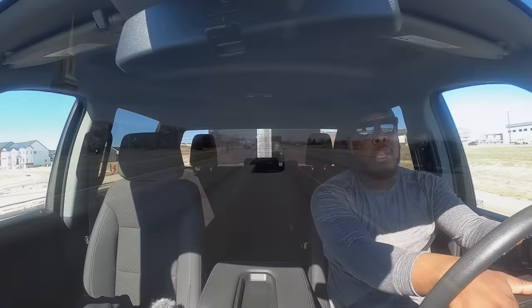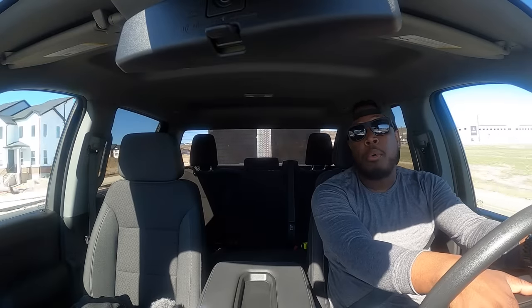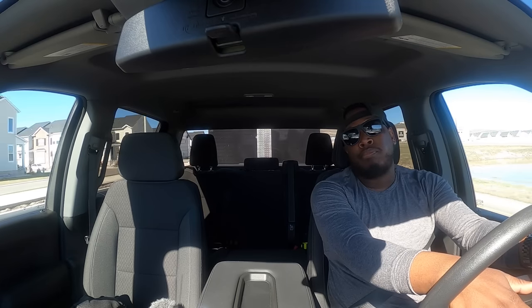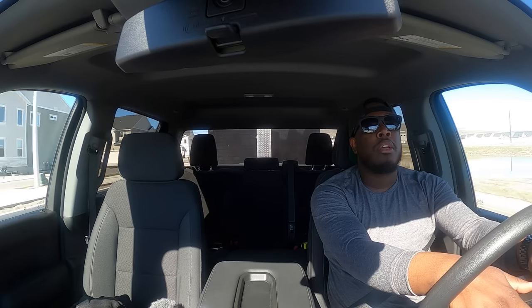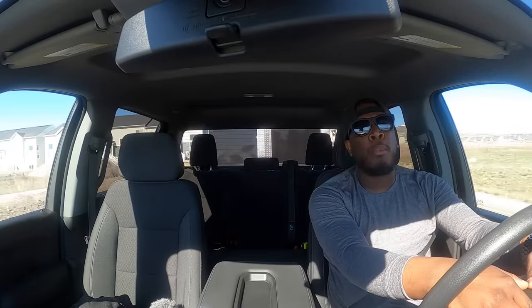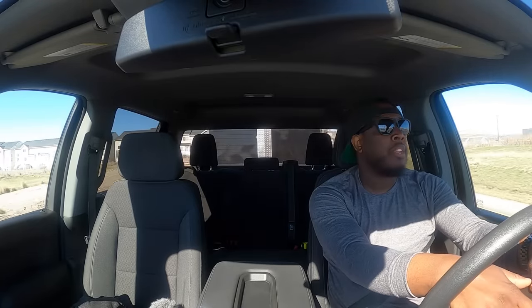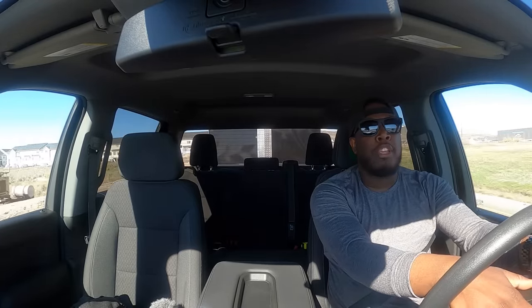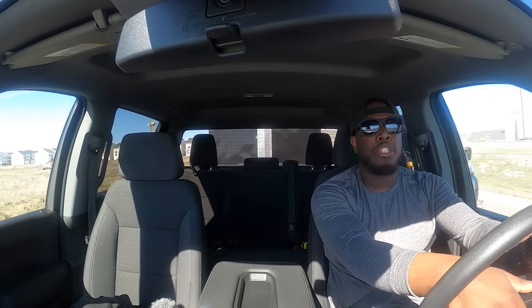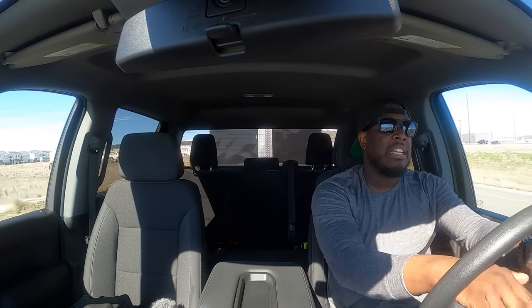And I just have to put my money where my mouth is and go rent a 5.3 liter Silverado and tow with it. That's what I have to do. And then we have to try to get a diesel. This truck, the owner said 85 was fine. I don't do 85 for towing videos, so I tried to burn out as much of the gas as I could. And then I filled it back up with 91, because when you're doing this type of towing, especially with this little engine, you need this thing to be operating at peak performance. And this truck definitely needs that.